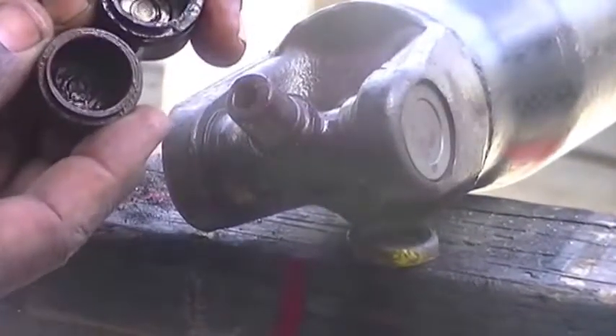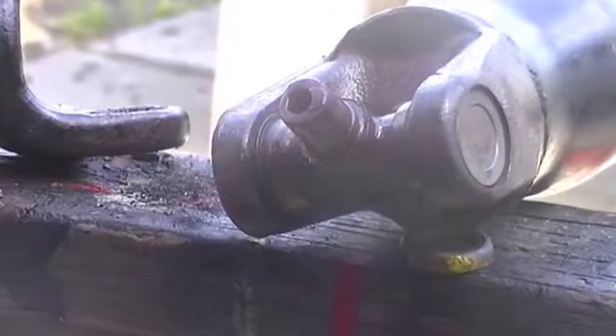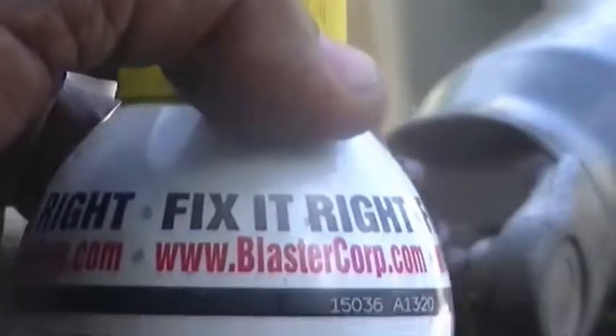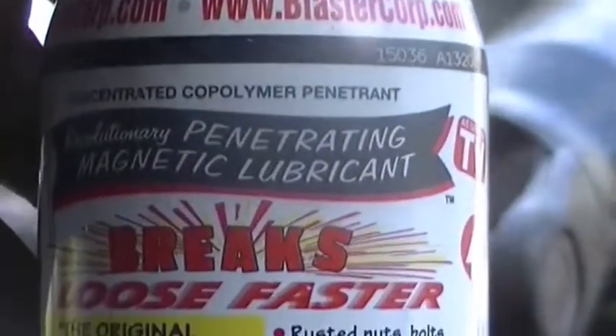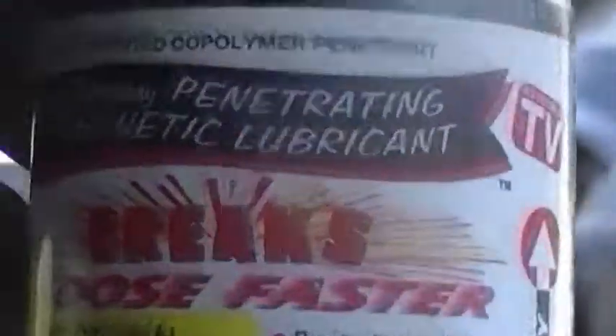There you have them — two of them. One dry problem. One thing I forgot to show you: a lot of times when I've got a job like this, I usually use that penetrating oil. To me it works really good on a lot of things. That's the penetrating oil I use — there are several out there, but this is the one I use all the time. All I do is spray the parts, let it soak in — I usually let it sit about 3 to 5 minutes — and then I start hammering away.